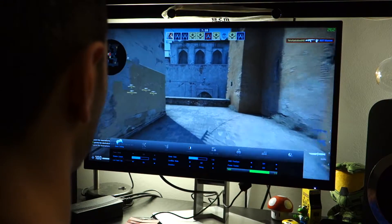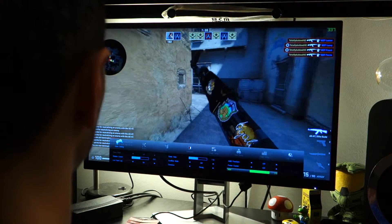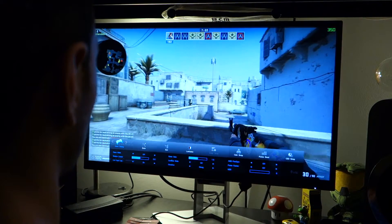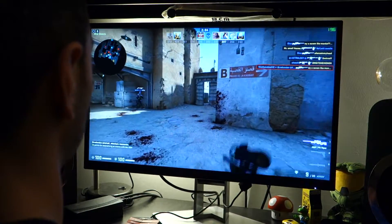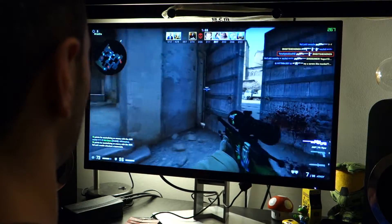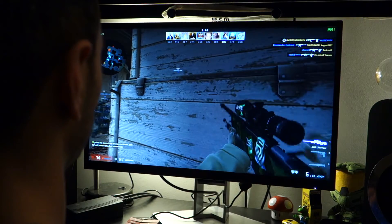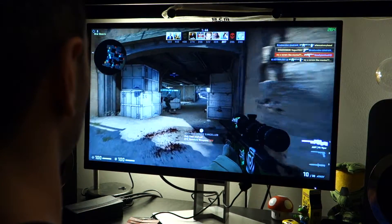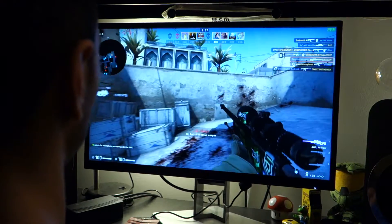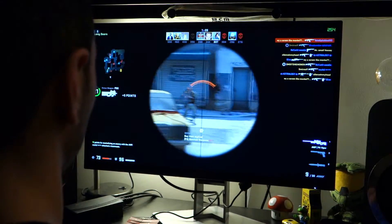The same couldn't be said about this AOC 240Hz monitor. As for response time, it's a bit of a double-edged sword. You can run it on boost mode to get as close as possible to that 0.5ms MPRT. However, I see most people running this on the strong overdrive setting, which doesn't limit brightness — but as a result you will see a little bit of inverse ghosting. In a game like Counter-Strike that doesn't really matter, but if you play more casual games on the side, that inverse ghosting might get distracting. You might want to dial down overdrive to medium or even turn it off, at the sacrifice of a more responsive panel.